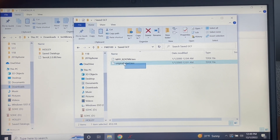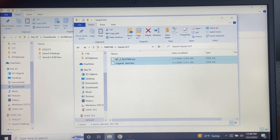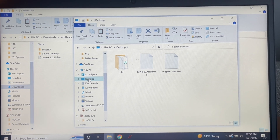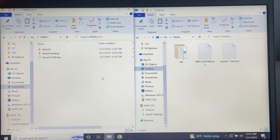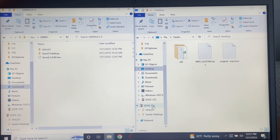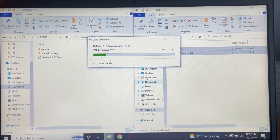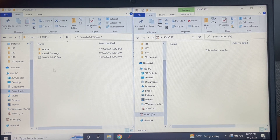For safety, we're going to select these two files and save them to our desktop. We're just going to highlight these, hit copy, go to desktop, and paste them. Once you've got that done, the next thing you've got to do is delete everything off of your SD card. To make things easier, I'm going to split screen this. We have our SD card on the right and the downloaded file on the left. We are going to delete everything. If you want to permanently delete, yes. It's going to take a second and wipe out the card. Now you can see that the SD card contents are empty.